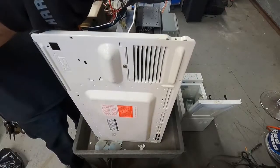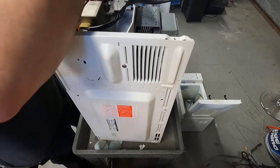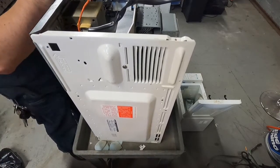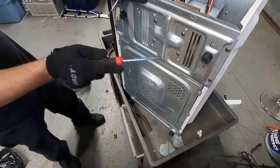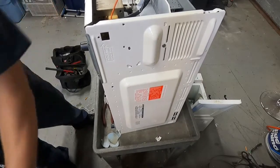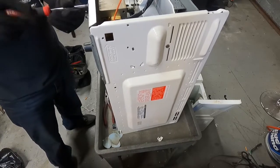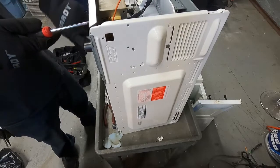Now I can actually start seeing what's going on in here - all these wires are tangled on each other. The circuit board right there - this switch right here has a spool in there with a silver contact, that's pretty easy to get to. I might take the board off. There is another board under here for the keypad but there's nothing on them, so I don't even bother. I'm going to take the transformer out - always leave the top screw in and one of the corners. Before you start removing the last screw, just loosen it up a little bit because gravity will hold the transformer in place.